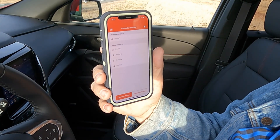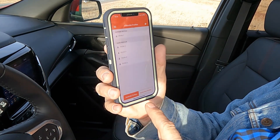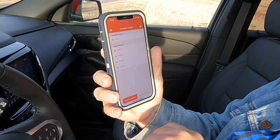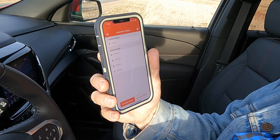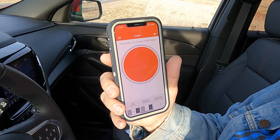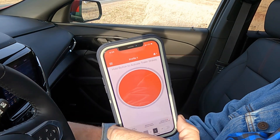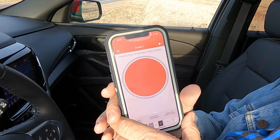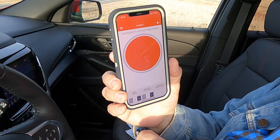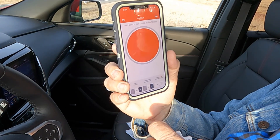At the bottom you see it has controller profiles and application profiles. I'm going to hit number one — and there's what you want to see. I can either activate this on the phone, or on a truck without using the phone I would squeeze the little handle on the brake controller. That's how you apply pressure to the trailer brakes without applying the truck brakes. I just play with it until I feel like the brakes are coming on right — not locking up but giving plenty of brake power.